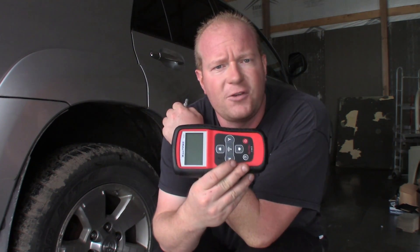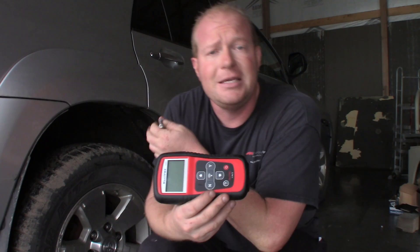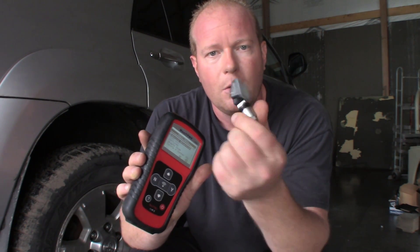My challenge to them was: that's fantastic, but what about all the guys in the industry that have a TS-401? Maybe you've got a TS-401 with your DS-708 back in the day and it was a free tool, or maybe you picked it up as just an inexpensive TPMS tool. They said you're in luck, because your TS-401 will work with the One Sensor. I said how does that happen? They said with an update. So make sure you update your tool — currently I'm on version 5.30 to use my TS-401 with the One Sensor.